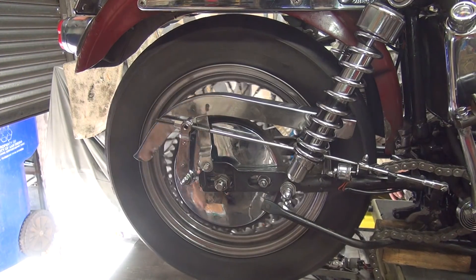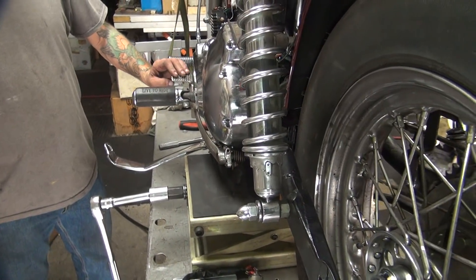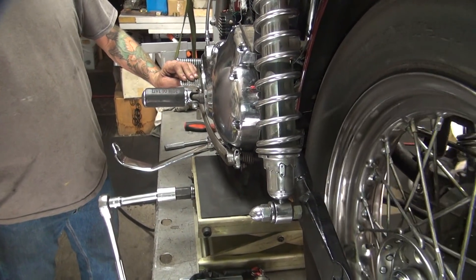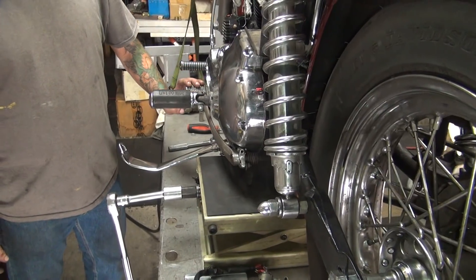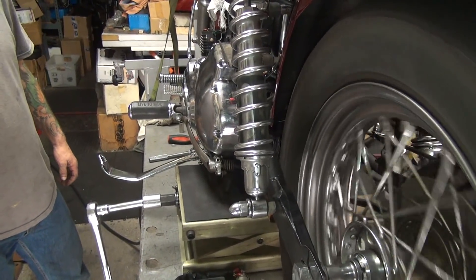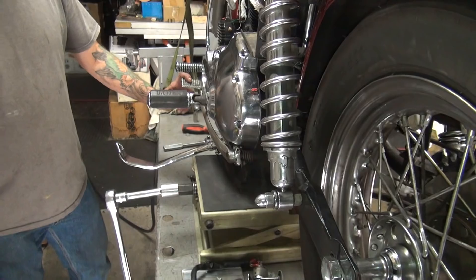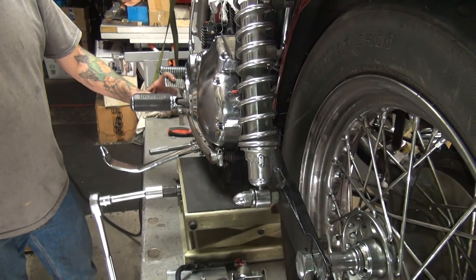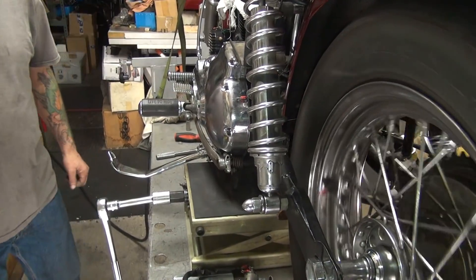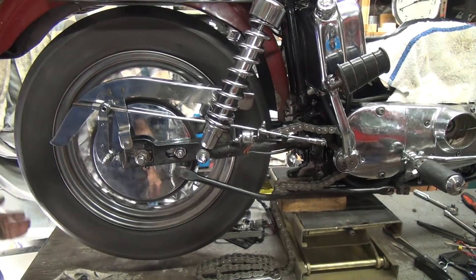I just barely put pressure on the shoe — just enough to hold them up — and then I tighten and force them on. I think it's flexing the plate causing issues. How far is the pedal moving? It needs like a half inch. It just releases instantly. It's barely dragging right now — that will wear in. That's a lot better, I'd say like half the drag it had before. So some good lubricant on parts and freeing up other stuff seems to make the brakes work better.